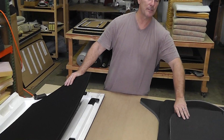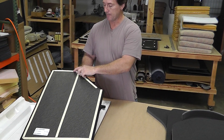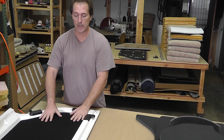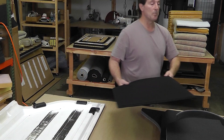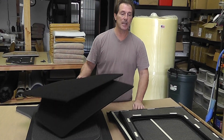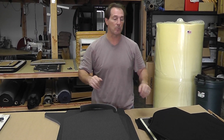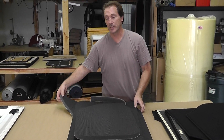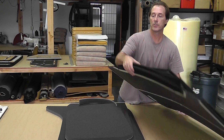Neither one of these are removable. If you ever tried to take this off you're going to have all that adhesive — it would probably be a big mess. I've tried to pull some of this off and it kind of tears the foam. So once these are in, they're in. For Mopar, to do the fronts you obviously don't have to take them off. But to put the back pieces in, the instructions show that you've got to lift your hard top up and stick like a two-by-four in there so you can get underneath the sound bar, because it has parts that stick out that go up underneath there. We didn't feel it was worth taking your top off to do that.